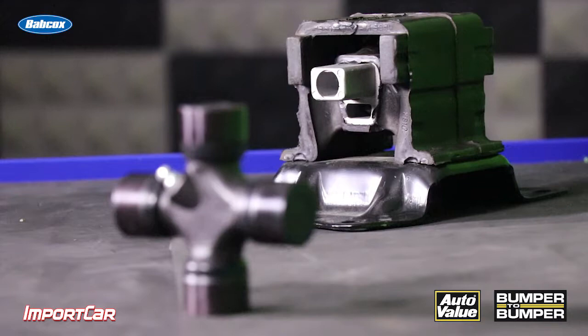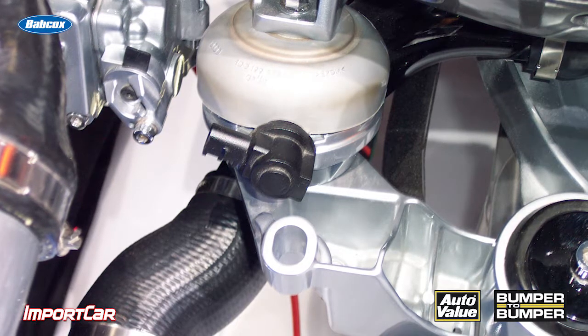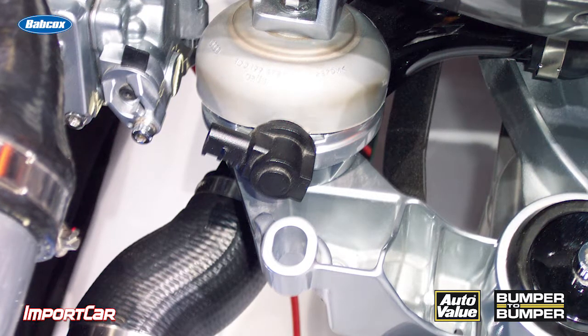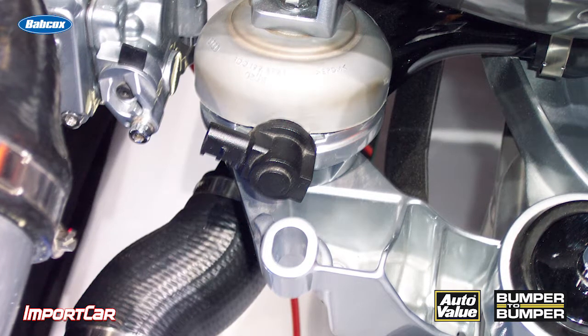You don't really want to pry on the motor mount, but see how much play is in it. Check the motor mounts from side to side or front to rear. In some cases it's a hydraulic bushing — once it fails, chambers inside could leak out the fluid and cause it to no longer be able to keep the position of the engine or absorb vibration.